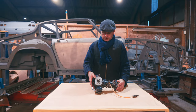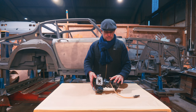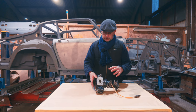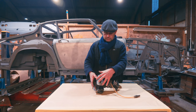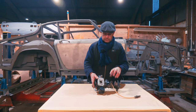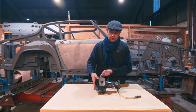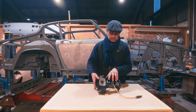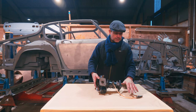So on the bench, what we've got: we've got delivery to number one cylinder via this union, and then we've got our pipe going down to it and our injector. This is the metering head - this is what does the control - and this is the actual distributor part of the body. So we've got the high pressure fuel in there, and then we've got a vacuum delivery here. This is controlled via the vacuum, so all this controls the vacuum and decides how much metered fuel will be injected into the engine via the corresponding pipes and injectors.